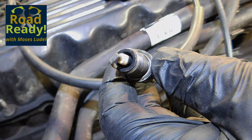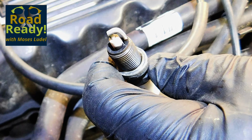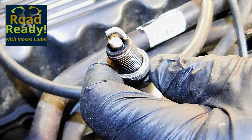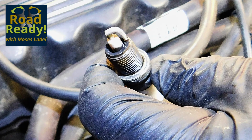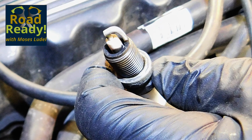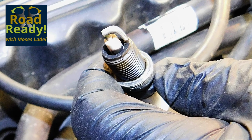The whitish deposits that you see on the grounding strap are an indication of poor fuel choices or heat. In this case, it could very well be just poor fuel choices. We run low octane fuel without additives in this engine and have done so for a long time. It's tolerant, but obviously it's taking a toll. Quality fuels like Shell or Chevron with Techron help remove deposits, and they also cool the engine slightly from that improved combustion and cleaner upper cylinders.